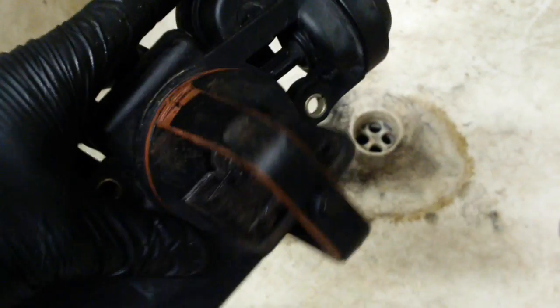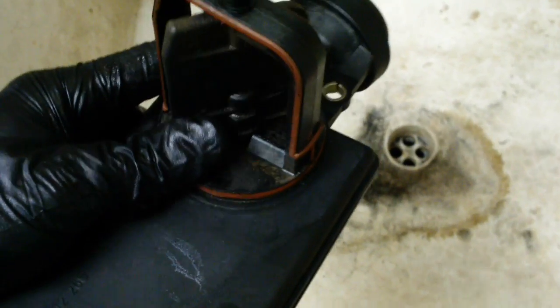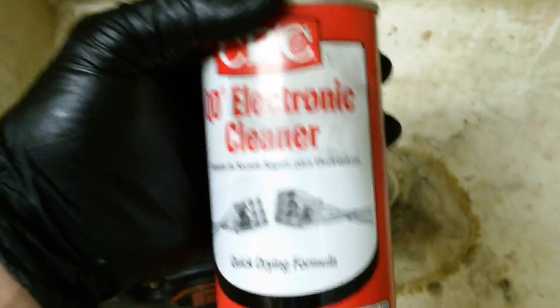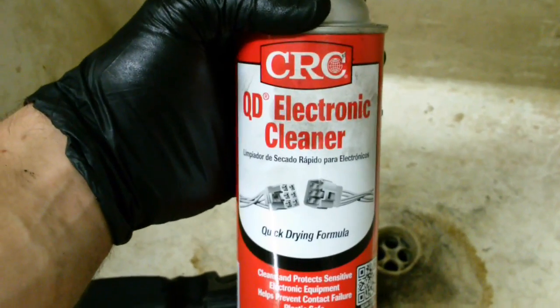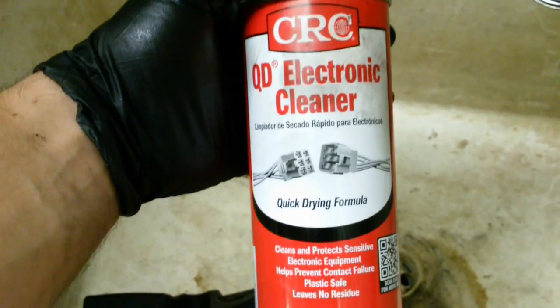My DISA valve was not doing that when I first took it out of the car. I'd put my finger on it, let it go, and it wouldn't remain with any suction at all. And I was like, why not just clean it before I throw it away? So I took this — the electrical cleaner. This is the biggest find of the E46 century, so please pass this video along to anyone who has this car, because this will save them 300 plus dollars.